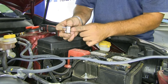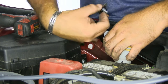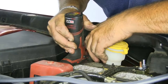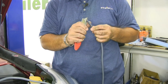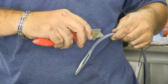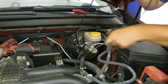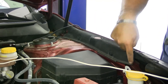We need to find a place to mount the breaker. I popped this panel off and have just enough room to get my drill back in there to put my self-tapping screws in and mount it back here. You're going to see two prongs — it's going to be marked battery and auxiliary. Battery is going to be the copper color, auxiliary is going to be the silver color. I'll drill the hole first. Next, we need to get our black wire out from inside of this coating — make sure you're careful when splitting the coating that you don't cut into the wires.